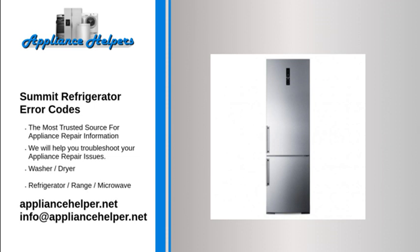Poor refrigerating efficiency. Did you put in hot food or too much food? Put food into the refrigerator only when hot food becomes cool. Did you open the door frequently? Don't open the door more often than necessary. Is a food container or bag caught in the door seal? Check the door gasket. Direct sunlight or near a furnace or stove — remove the refrigerator from the heat source. Is it well ventilated? Clear any obstructions to maintain good ventilation. Temperature setting too high? Set to the appropriate temperature.